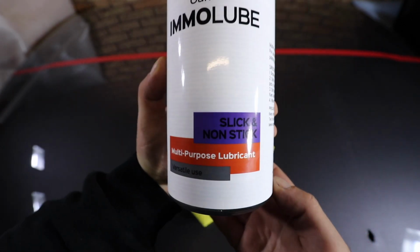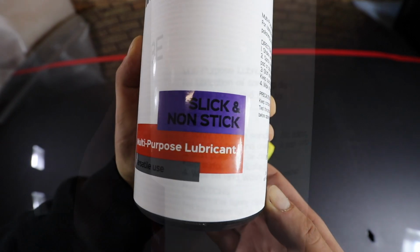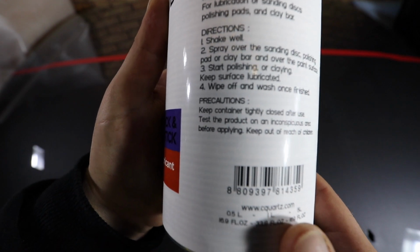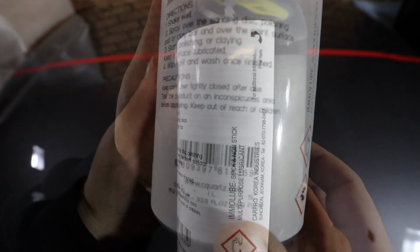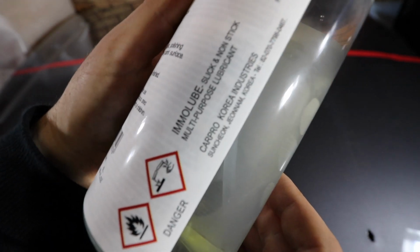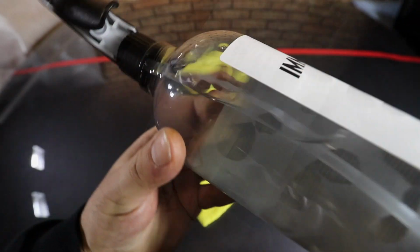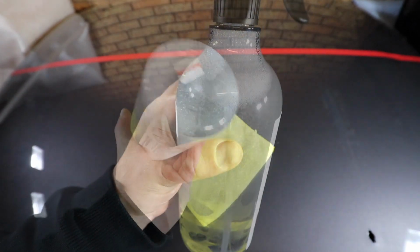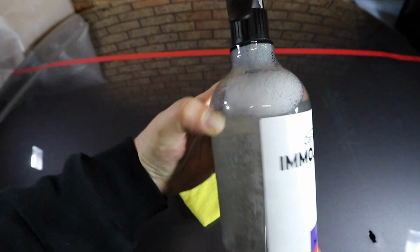Claying a vehicle, whether you're using traditional clay or a more modern clay towel, mitt or polyshave block or pad, is such an important step in removing bonded contaminants such as environmental fallout and traffic film buildup, simply for the fact that many of these particles that are bonded to the paint can't be as effectively removed in any other manner. And if left on the vehicle, they will over time begin to permanently etch and compromise your car's paint, as well as limit the quality of finish you can produce when correcting a car's paint.